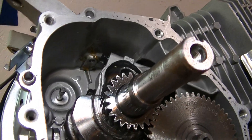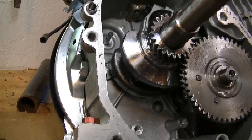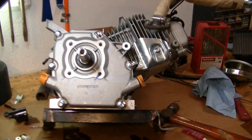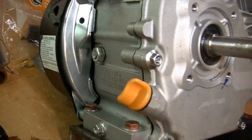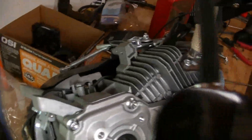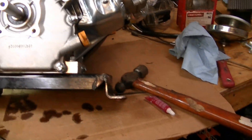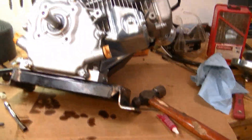Make sure if you plug these with a bolt to put some red or blue Loctite — I like red because I don't plan on taking this back off ever, so that'll lock it down for good. We've got that bolt through the side with the Loctite on it as well as the top one, and we've got the side cover back on. Now we can throw our air filter back on and our torque converter, which is laying right there, and this thing will be ready for the go-kart.